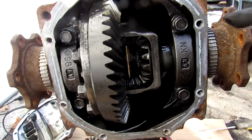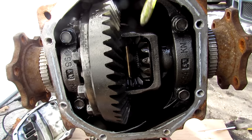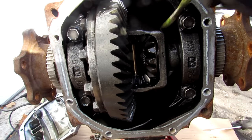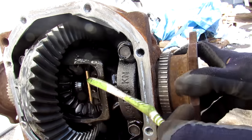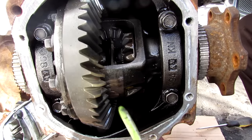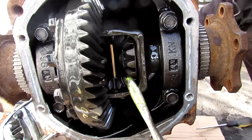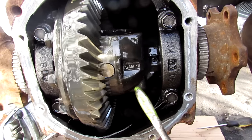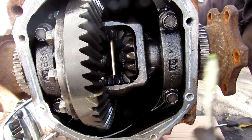Now here we have a nice clear look at the guts of this differential. On the side here we have the two main bearings that the guts of the differential ride up against inside of this housing. This big gear is the drive gear, and way inside of the back there is the pinion gear that drives it. Now further inside of this housing we have the four small differential or spider gears. As I rotate the input shaft of the pinion, you'll see that this drive gear also rotates and it rotates at the same speed as this carrier. Inside the carrier, you'll see that these gears are locked and they're not rotating relative to each other, which means that the right side and left side wheels are moving at the same speed in the same direction.